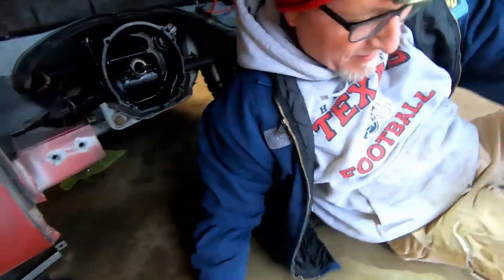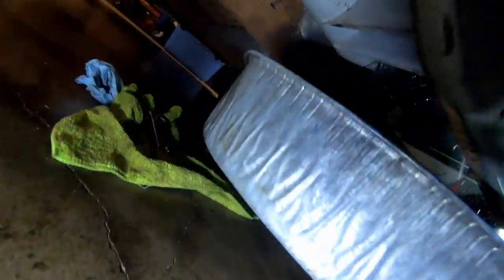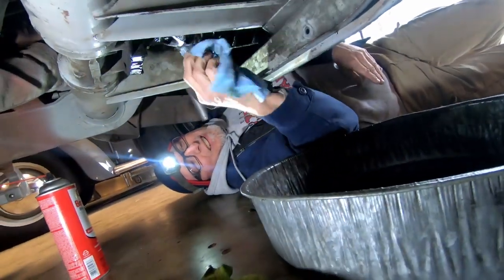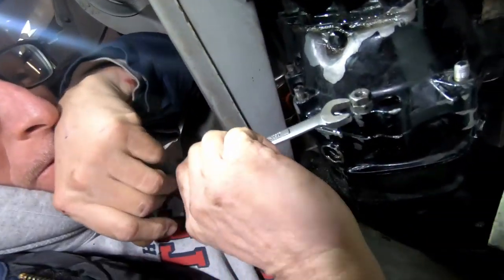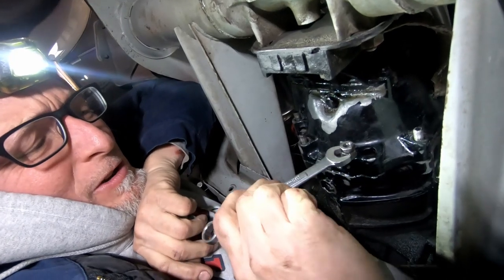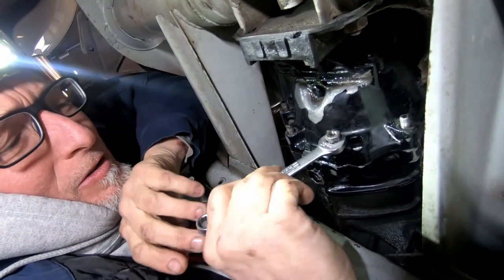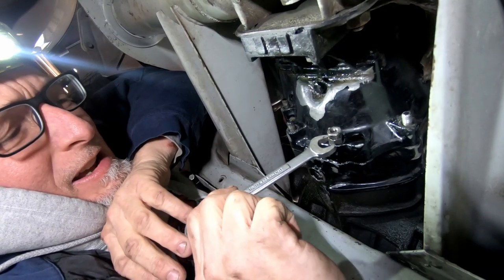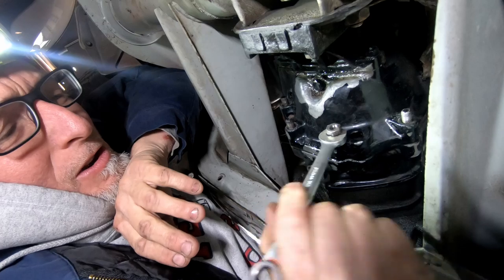Really, this is the hardest part — getting the nuts off the gearbox. They're usually pretty dirty. In this case it's not real bad, but we're going to give it a quick cleaning. You might have quite a bit of gunk on your gearbox. As we showed you earlier, these are those studs — you've got to remove these studs to put your bracket on to the transmission. Clean everything really good, and then put on these little eight millimeter nuts: put the original one on and put another one on and snuggle them up against each other — they're really tight.